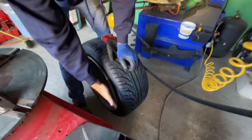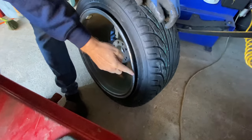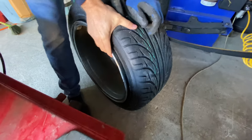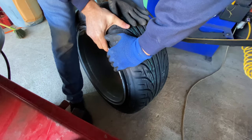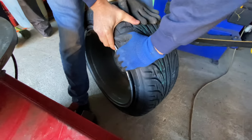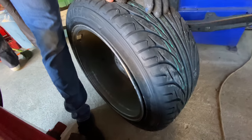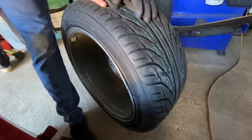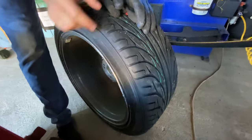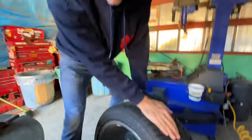So it's blowing out right here, I can feel it. And you'll see there's a dent here. So somebody put a big dent in my wheel, it was probably Chandler. Definitely wasn't me, I would never dent my wheel. So I'm gonna pinch this a little bit, which is pushing the tire down, and now it's taking air. I'm gonna move my hand off that so it doesn't pop too hard, but that's all it took. You see how I diagnosed where the air leak was, and then I grabbed it. Somebody dented my wheel, Mark. It wasn't me.